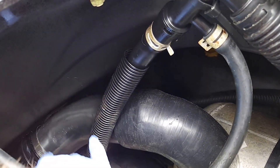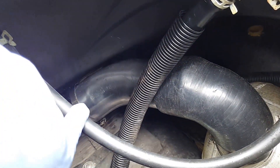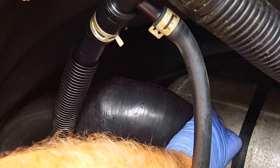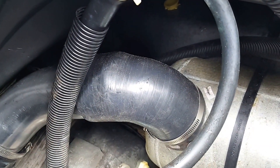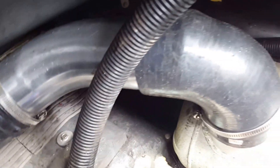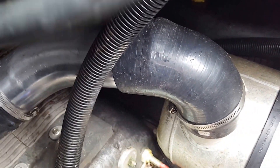Here it is — I've got everything in, got my 90 on the water box. It's very important: do not tighten any of these clamps yet, because you don't know how far the 45-degree has to slip in. You've got to be able to move it around. You can put the clamps on, but do not tighten them until you finally have everything fitted and sitting nicely right in the hole. Flow-through exhaust, under an hour, under 40 bucks — can't beat it. Thanks for watching.